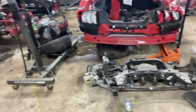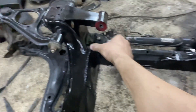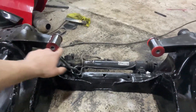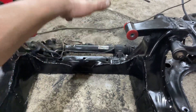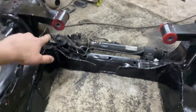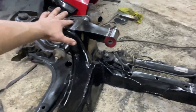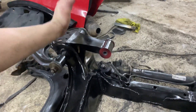What I did is I had this laying down on some jack stands and had the motor — the transmission wasn't on it — but I slowly lowered the motor down, had these here, had the bolts going through them but they weren't tightened down so they were able to move. Once these two were attached to the motor, they're exactly where they're going to be. I lowered the motor down and brought this side and that side to be about a 16th of an inch left of that small hole, and that allowed it to be dead even on both sides.